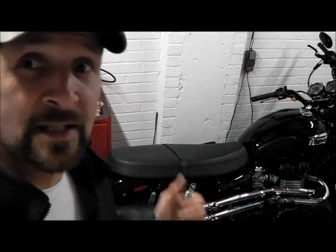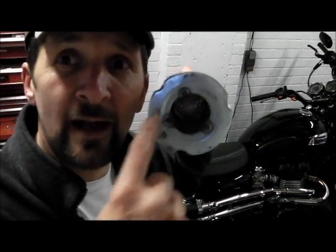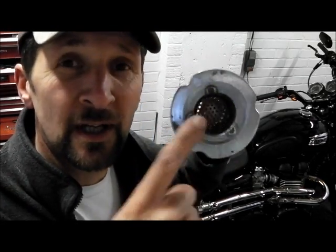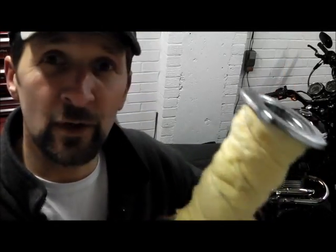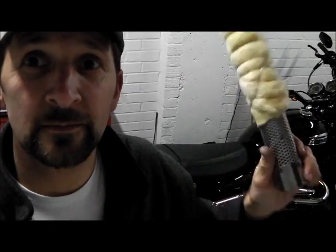I don't think so. Now what I'm going to try and do is give them a quick dB test, open, with nothing in them at all. They're just empty. They're double skinned, but they're empty. There's nothing in them. So the megaphones expand the sound and then crack it back in at the end. They work quite well in that respect. But these baffles have got that cheese grater thing with a garlic crusher inside. And without cutting that out, they're not going to be straight through. And wadding or no wadding, they're going to be quiet. They're probably going to be rubbish.